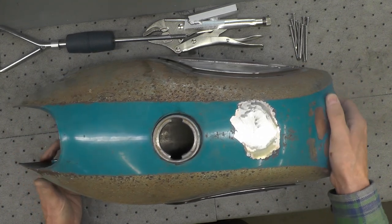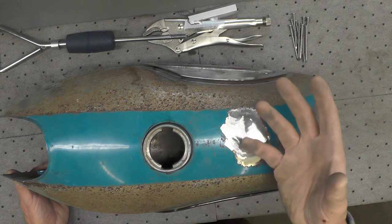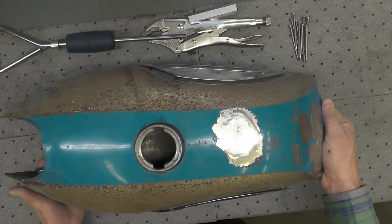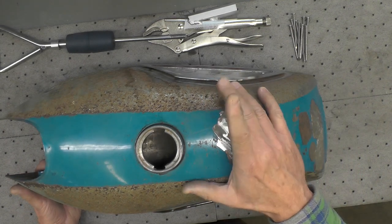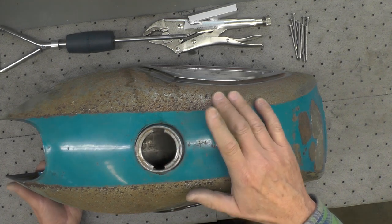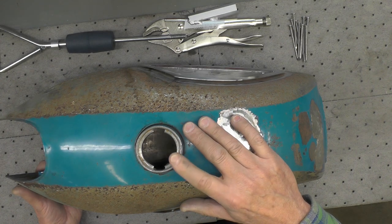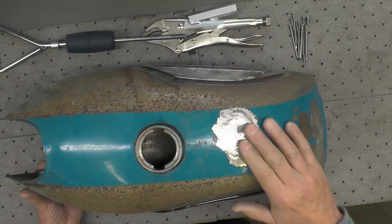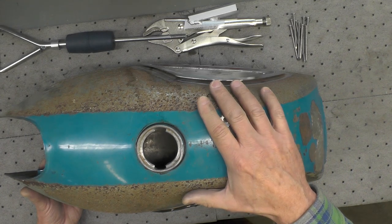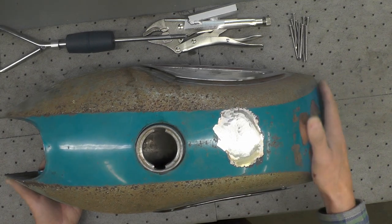Well, number one, it's a lot of work. The components, it usually comes in a can. Sometimes they're two parts, sometimes they're single. It's relatively expensive. It's a lot of work to do it right and do it well. The preparation work, the cleaning, the drying, getting it just in the right spot so that the liner will, in fact, be permanent. I have seen liners fail. I have had friends that have had tank liners that have failed, that they purchased and it was flaking off on the inside. I've encountered that in a few tanks myself.